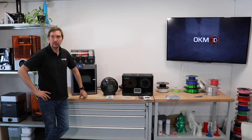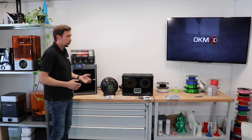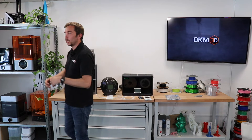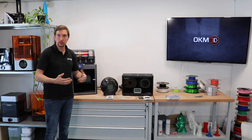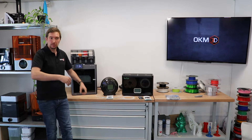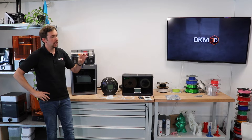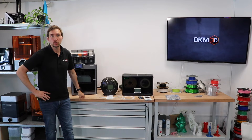The S2 is probably the best seller right now. Drying filament basically helps you get consistent quality, because filament left open will collect humidity from the air and lose print quality due to the extra moisture. That water needs to get out before the filament can be correctly melted. So you will have stringing, blobs, and holes if the filament is not dry enough.